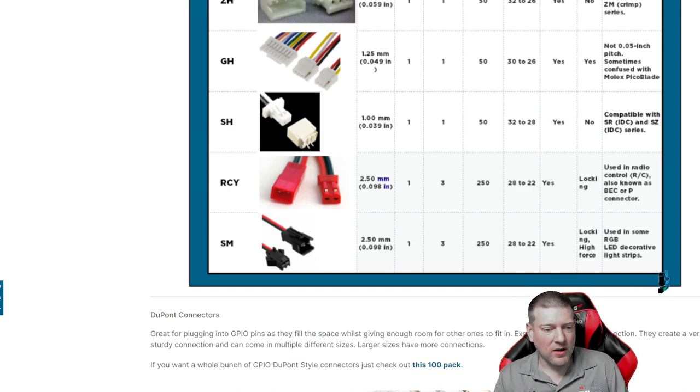A lot of these are more old-school type connectors, but we still have them all over the place. You can see they have an example of the blank connectors and the pins for the pinning kit. The pins come on a strip — it's folded metal. You place the wire in it, crimp it, and it snaps into the connector. They have little barbs that retain themselves inside the connector.